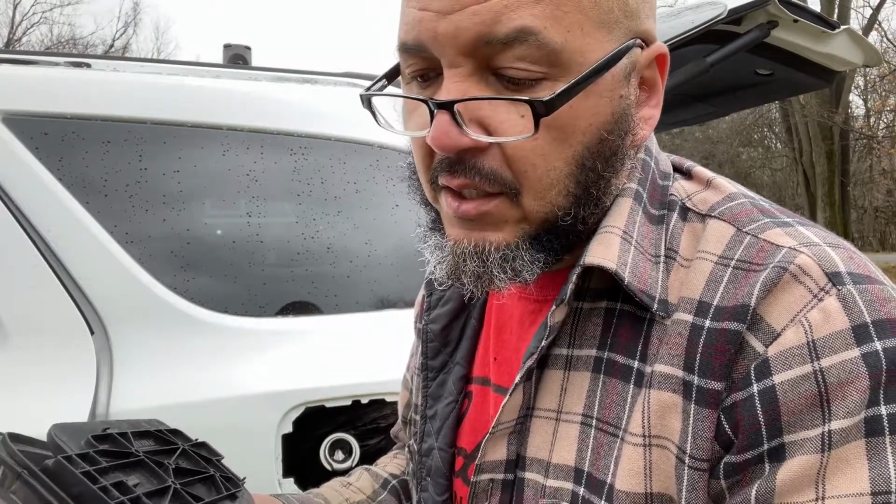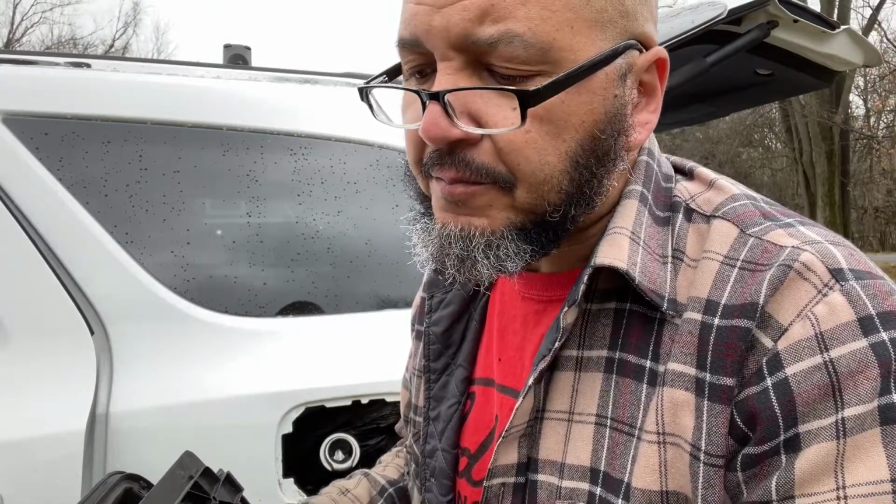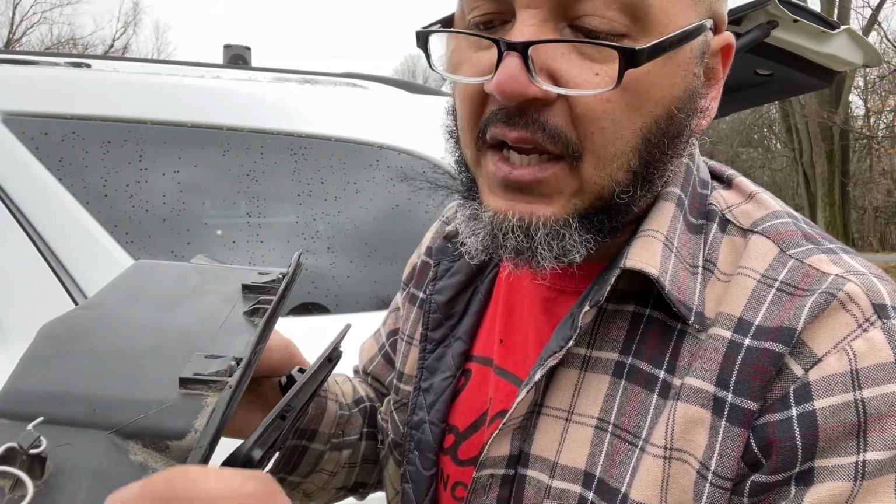It was a quarter inch steel rod. I made sure that it was the right size to slide down inside here, which was the same size of the plastic piece that came out. And the plastic piece had a flat piece on the top of it. And that's what broke off. So what I had to end up doing, I had to heat this round rod, and then flatten it out, drilling a hole in it to accommodate the spring so that we can get that spring action once again. So I ran into some troubles, but because of quick thinking, I got it fixed.